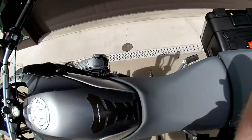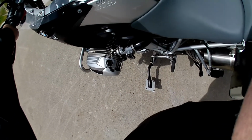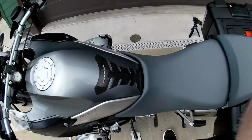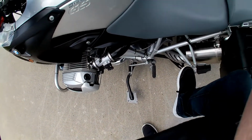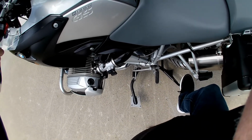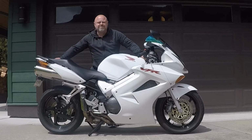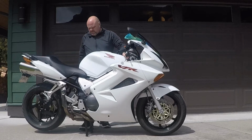Standing the bike while holding it from these two positions can be a little bit of a challenge, particularly if your bike's heavy, so you may want to get your bike vertical and off its side stand by positioning your right hand and right leg closer to the seat for leverage. But this is pretty much the extent of upper body exertion, and you need to return your grip to the rear of the bike and stand back until your arms are almost, but not completely, outstretched. Basically, you're making a tripod using your body and the two tires of your motorcycle. Holding your bike in this position can be awkward at first.